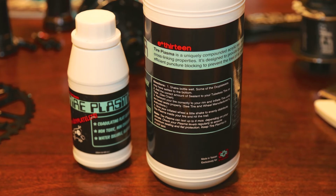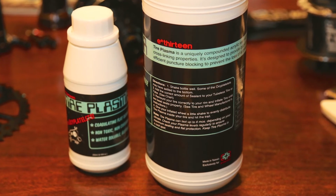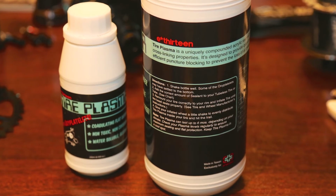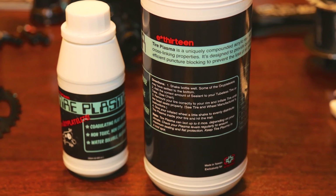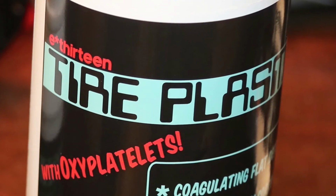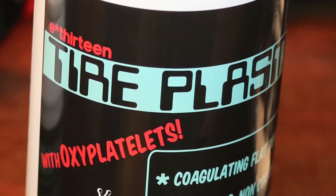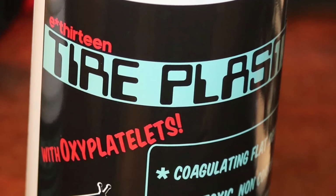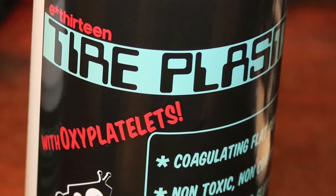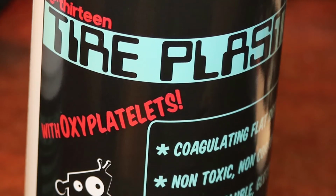And basically how this functions is it's an acrylic resin-based mix, so super inert, won't react with your tire or aluminum spoke nipples, the rim tape, any of that stuff. You won't have any issues there. Completely water soluble, so if you eventually do have a problem where you have too big of a cut in your tire and have to put a tube in, you can basically not be worried about dumping a big pile of latex or crazy neon colored stuff on the side of the trail. Pour this out, you can dilute it with your water out of your Camelback and not feel bad about it.